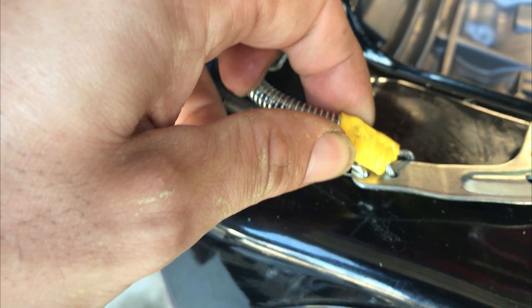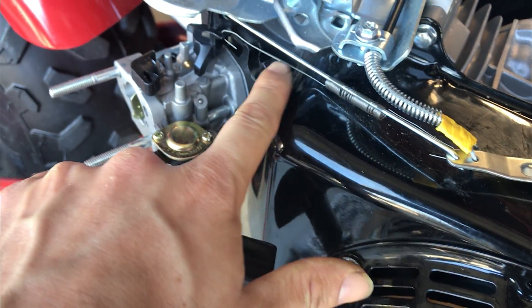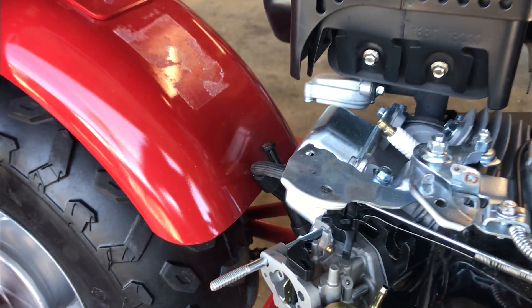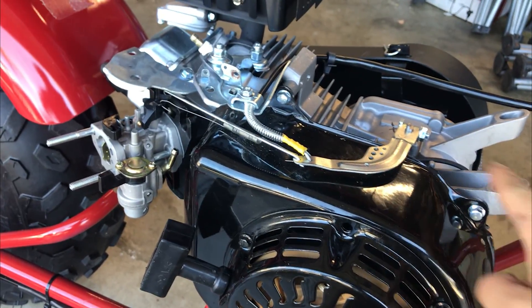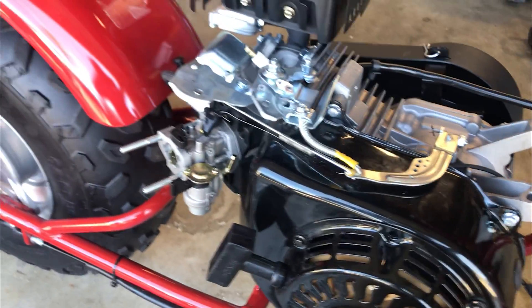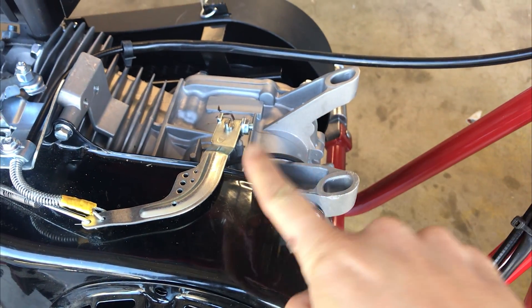I have hardwired the throttle cable — it used to come over here, it now wraps along the backside of the tank and screws in here. I use the stock throttle spring. As you can see, a little crimp connector — I connected the throttle cable through the standard hole with the crimp connector, and this is hooked up traditionally how it would be on the stock bike. The only thing we've removed is that old throttle spring that used to sit in the little center hole right there, under the throttle connection piece. So what's nice about this is I can pull the throttle wide open and the bike is wide open, but it also springs back to idle. Once there's vacuum on the motor, it'll go back to idle — so I don't need to have a return spring anywhere like you see on the predator motors when people modify them.